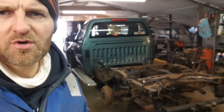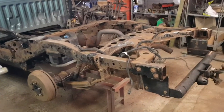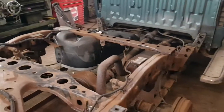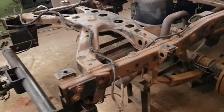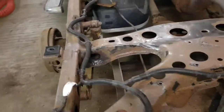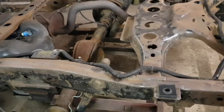Now we've got it in the workshop, I've taken the wheels off so I can get at the chassis more easily. As you'll see from the photo in the video, the chassis was quite rusty when we took the back off, but it was pretty solid — not too bad. I took a small hammer and tapped everything on the chassis so any loose rust just fell off. Then I took a needle gun and needle-gunned all the steelwork, which really preps it ready for painting. It also reveals any holes, rust spots, or thin spots by busting through them, which tells us where to repair.